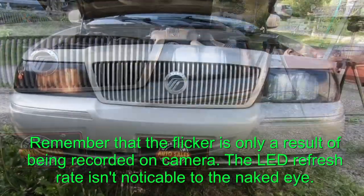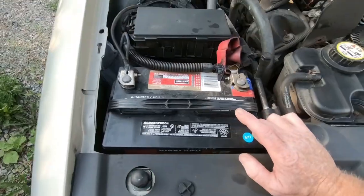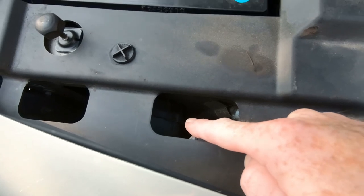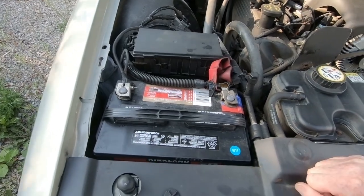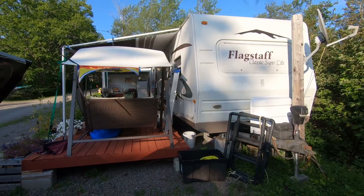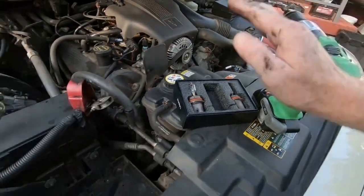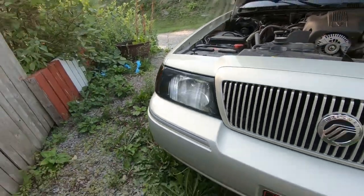One thing you will have to do is remove the battery, because you likely won't get your fingers down into this little hole to change the other light bulb. So you've got to take the battery out and come in from that direction. I managed to find an 8mm socket to fit the end of my drill, which made it possible to get the battery out and get this bulb changed. Now we wait for it to get dark.